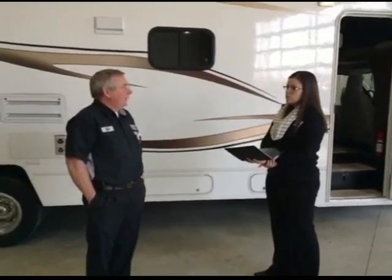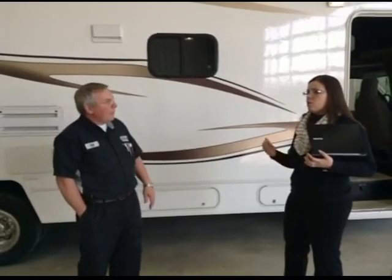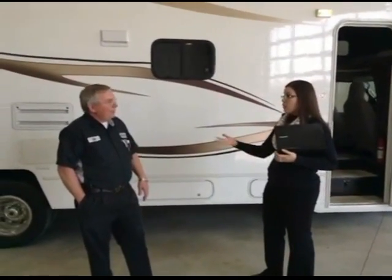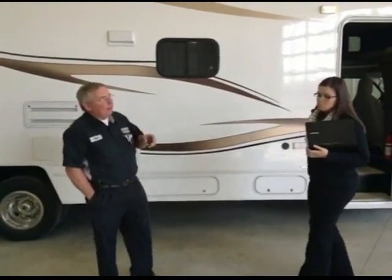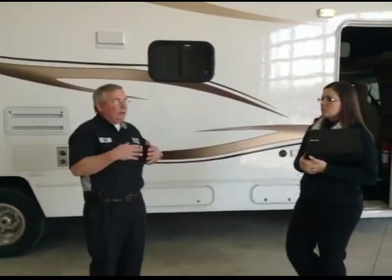Right. And the water just basically evaporates out. You should use distilled water when you're filling them back up. Just try to clean off the top of the battery so when you take your caps off, you don't knock all the dirt off the top of the battery down inside. And just check them at the beginning of the season, then check them in a month. And if they're still up there, check them in 2 months. If you're not using them a lot, and if you're going all year, then maybe next year you check them every other month, depending on how much you use them.